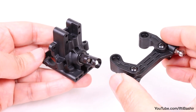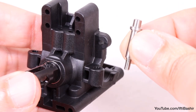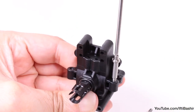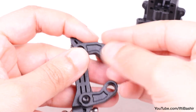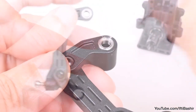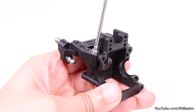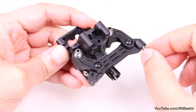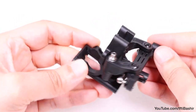At this point, we need to install the steering assembly that we've just built. We do this by using a 2mm hex driver to insert the two steering posts into the two sides of the bulkhead — we're only doing this to pre-thread the plastic here. So once in, we remove both again. Now with the thread created and with a bearing inserted into both sides of each bell crank, proceed to feed through the steering post and screw back into the bulkhead in the same places. Now that the threads have already been created, they should go in as straight as possible. Steering assembly installed and moving nice and freely. If you have any binding here, you need to backtrack since it's very important that the steering assembly is free moving.